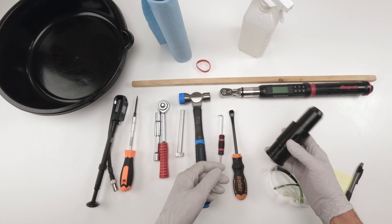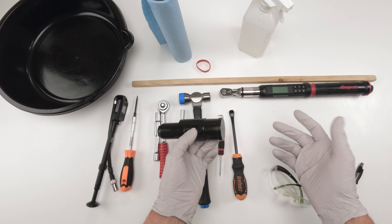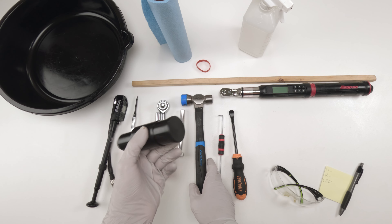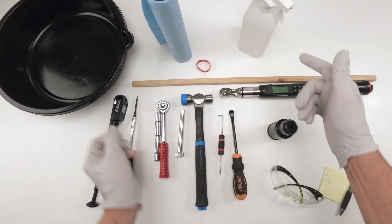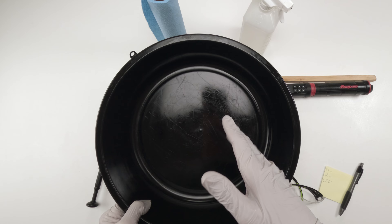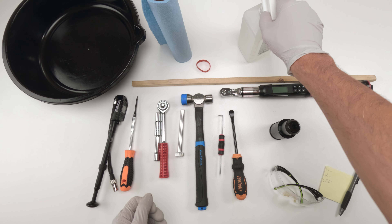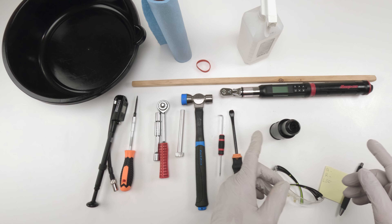Then we're going to clean the lower boots. I have a ritual where I use a dowel, a lint-free paper towel preferred, and a rubber band. We will go over that later, along with a lot of alcohol. Then to put everything back together, we're going to need a 34 millimeter wiper install tool and a mallet. We might be able to do it by hand if we get lucky. We're also going to need a torque wrench and an oil pan to empty out the alcohol, because there's going to be some oil in there. And that's pretty much it. Let's get into the air spring and damper tools.